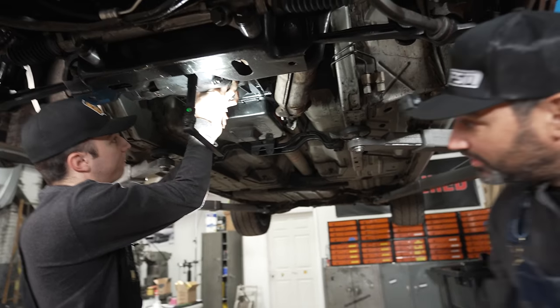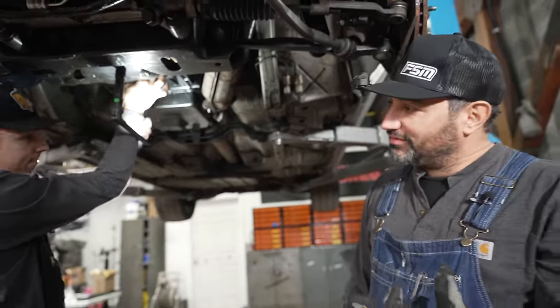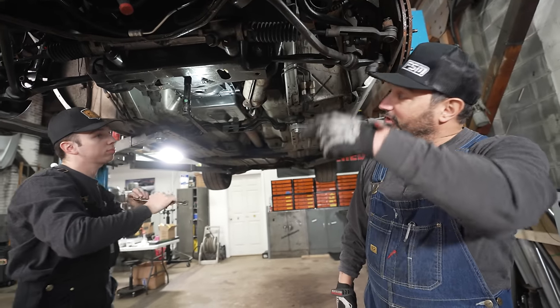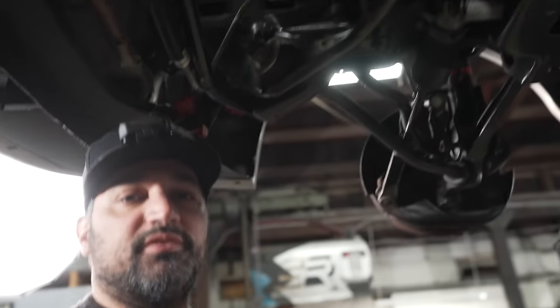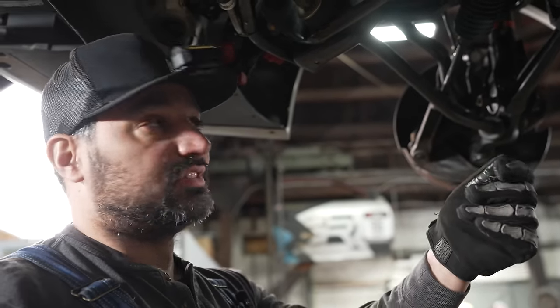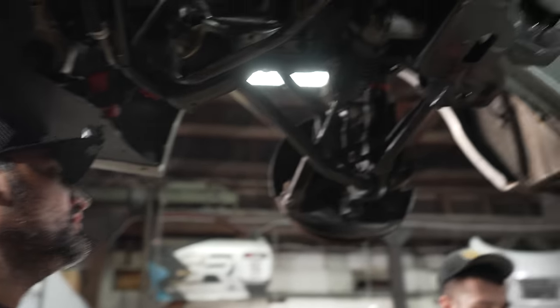You just generally get them in finger tight, make sure they're all in. Don't dare tighten one before they're all in. Then give it another pass, spin the engine around, and tighten them all up. Do this before you connect the starter, so you can just knock it in neutral and then into park with your fingers instead of having to go up and down in the car a bunch of times.